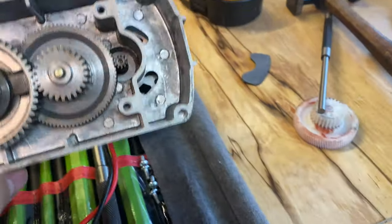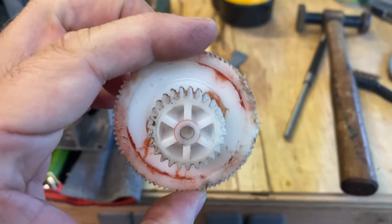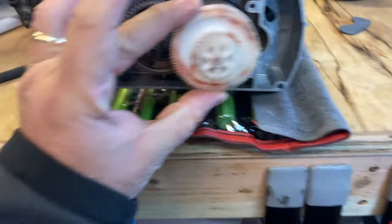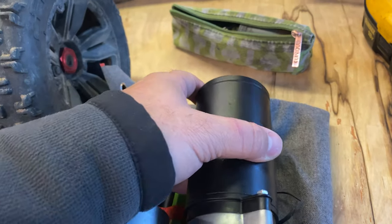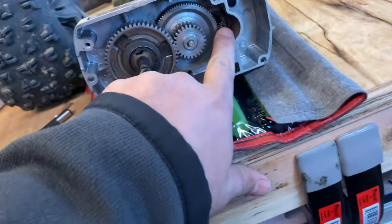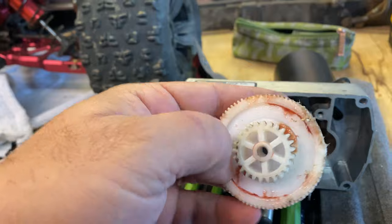Here's the new slide motor guts. I replaced this little plastic gear — you can see the flat edge, it goes in here. When the motor spins, this little black thing was all loose and cockeyed, so the shaft was coming in at an angle, and that is what caused this gear to get totally ground down.